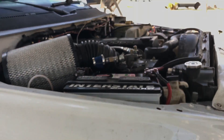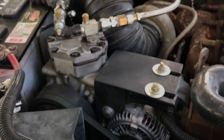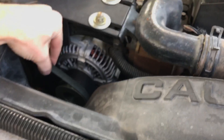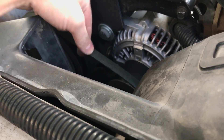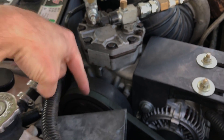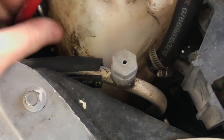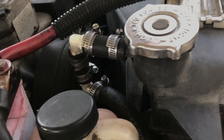That's basically the system overview — that's how it lays in the hood. There's plenty of room and it's been running almost a year. I did have to relocate the coolant reservoir — on this year Ram it was sitting right in the way, but there's plenty of room to tuck it in. Just be careful with your freon lines; I tucked heater hose around all of them so they don't contact anything. There's also a little rerouting for the coolant overflow — no big deal.